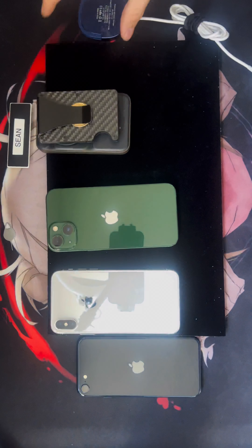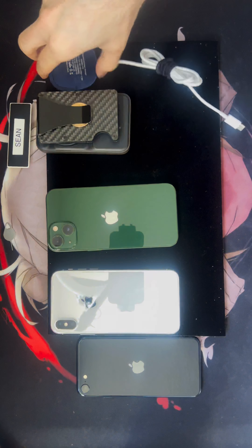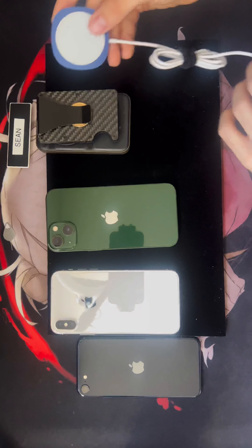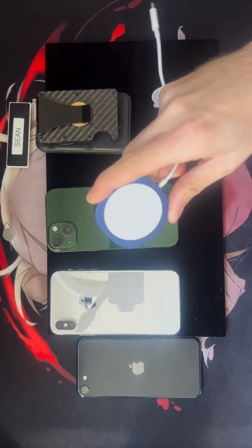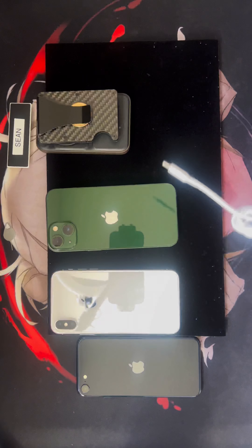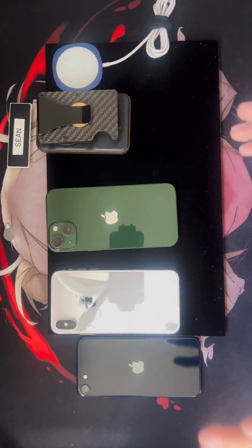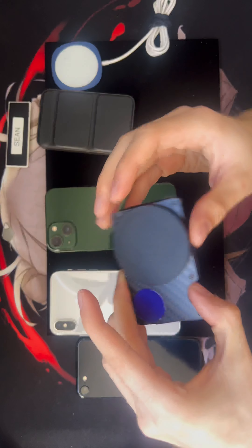Those are our three MagSafe demonstrators. The reason you'd want to use MagSafe is obviously wireless charging. I prefer this for overnight charging specifically, because overnight charging on a 30-watt charger really isn't good for your phone. These support up to 15 watts, so it's a bit slower. If you really want to be safe for your phone overnight, do like 5 watts, or just don't charge your phone overnight — that's the best thing for battery health.